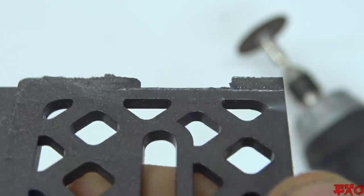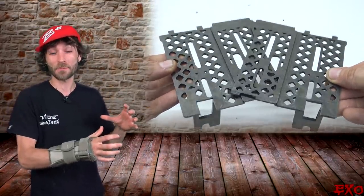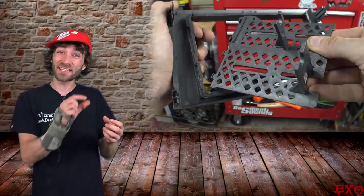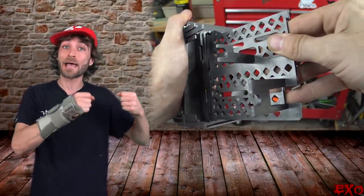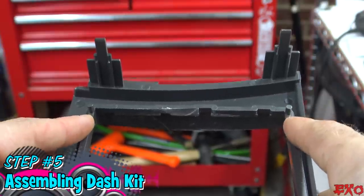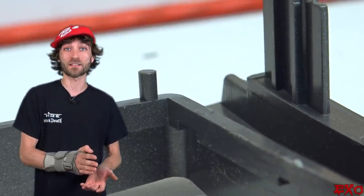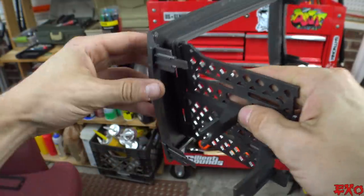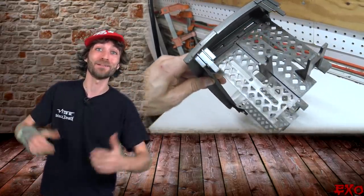Smoothed out nice and flat to avoid getting stuck on our double-din. To get the sides joined up, each piece has a little notch which faces the direction you want to snap onto the bezel. The two prongs on the top and bottom do most of the work — the sides just wedge between. Once they're both crammed into place, the head unit can literally just slip onto the whole kit like a pair of brand new fancy bricks.